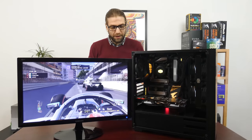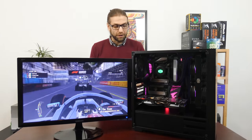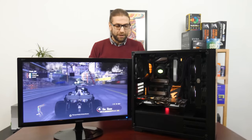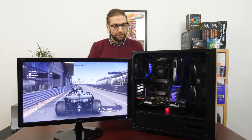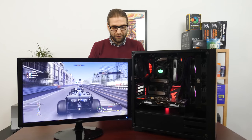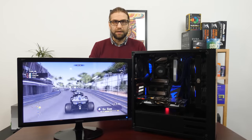I even tried moving around the storage. Just, even though that never really helps, I tried it. I tried everything and nothing would work. I put a new motherboard in, a Gigabyte motherboard. Managed to get it to at least post with one RAM stick in. Just the one, no video card. And at that point I thought, oh, maybe I've solved it. Maybe this specific RAM is the way to go.